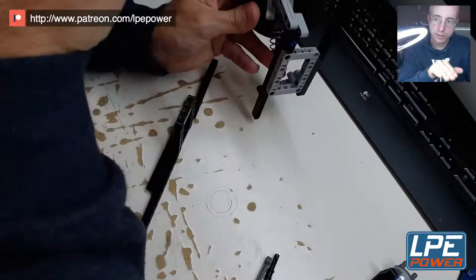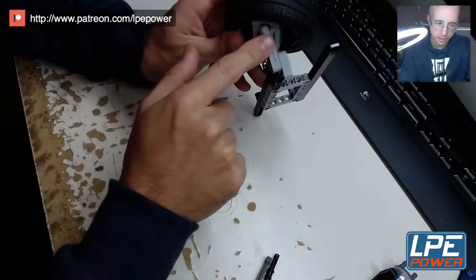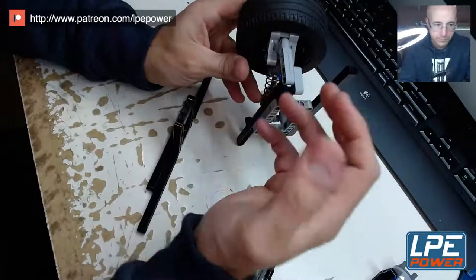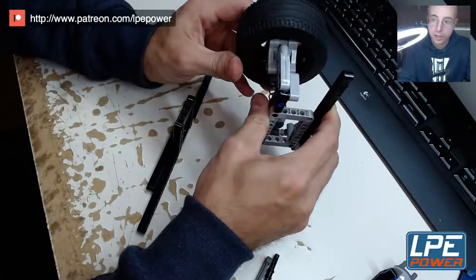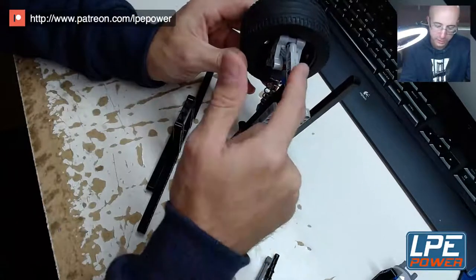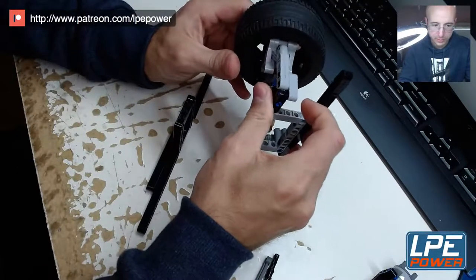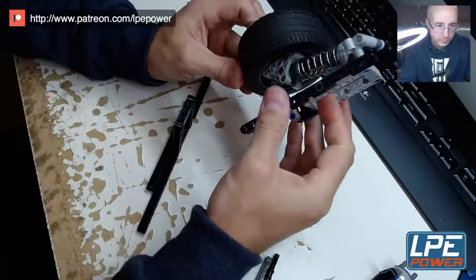The anti-roll bar is going to be where it is in the Sierra on the picture, only that in our case it's not gonna be actuated by the A-arm, I mean this twig or whatever you wanna call it, because that can happen. So we need to figure out how to basically locate this so that this doesn't happen. So we need a triangular structure here that's gonna clear the anti-roll bar. Basically, it should go over the anti-roll bar and locate it, I don't know, somehow triangularly, so we prevent this from happening. How we are going to do this, I don't know yet, but let's see.